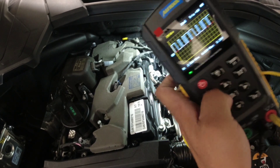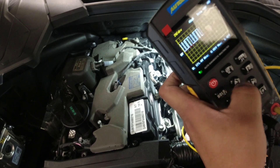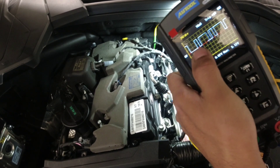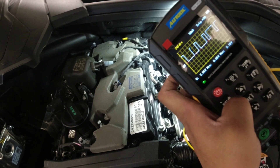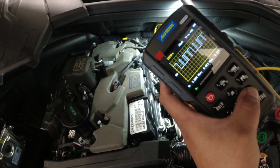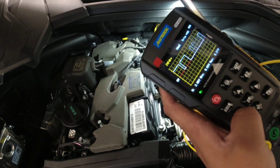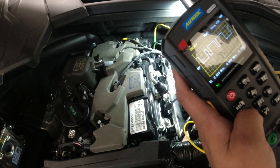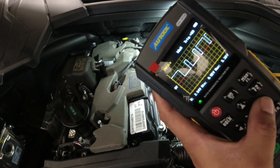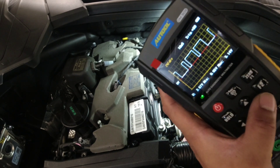I know there's some — I think that's the sample rate of the signal itself — so we have some not-clean waves especially at the bottom. But that's not really end of the world. Maybe if you're trying to evaluate a new sensor, that's the time you'd use the Pico scope so you can see more clearly. But as you can see, the signal is pretty nice and we can see the waveform clearly.